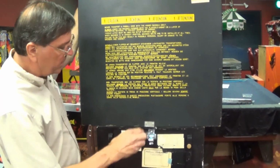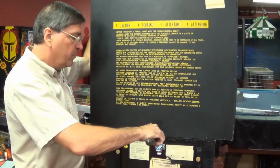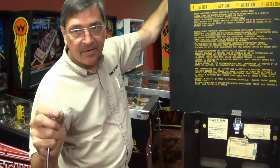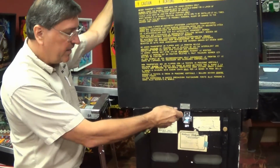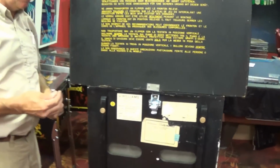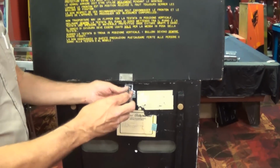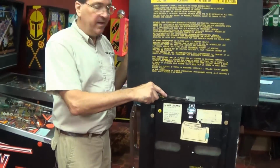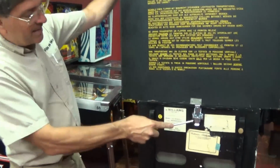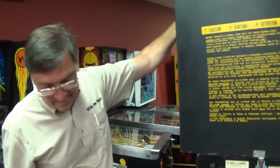It has 4 screws. They are fast wood screws, by that I mean they're coarse thread wood screws. But anything that's in here that's holding it, you want to take off. All right, that's off. We're not setting it on its butt. Same thing down here with your line cord. This plate is fine to leave on, but this you should take off or you're going to ruin it. That's why this has a new one on, by the way, because the old one was a disaster.